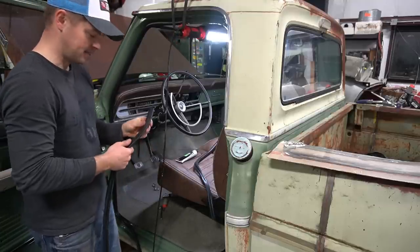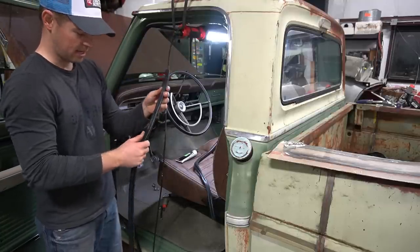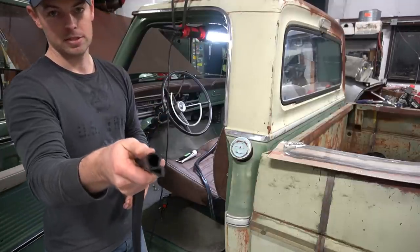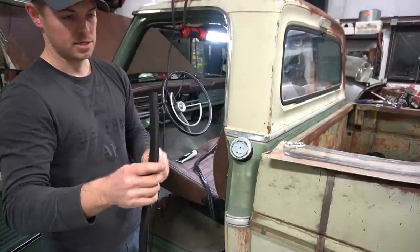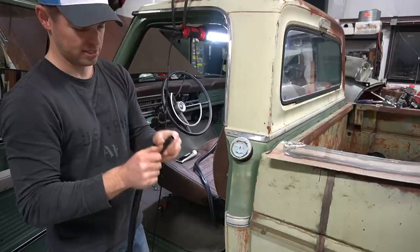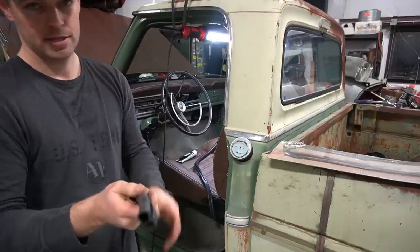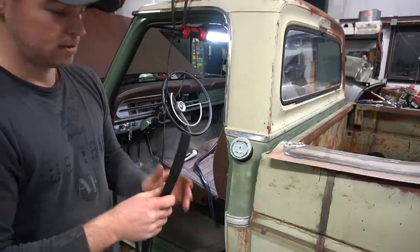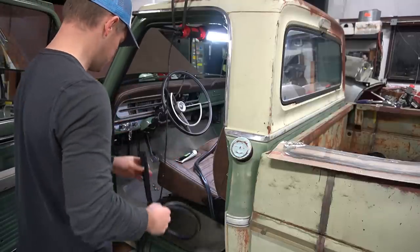This gasket isn't pre-molded by any means. It's just like a continuous strip of this style of gasket material here. So no need to, I guess, buy any that's Ford F100 specific or anything. Looks like you could just buy whatever style of gasket this is and specified number of feet, and then you could do your own vehicle. Probably save some money.